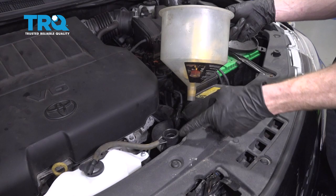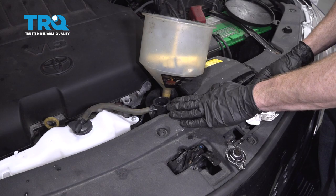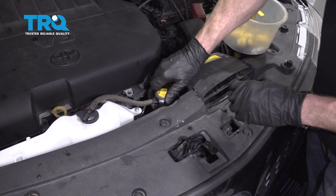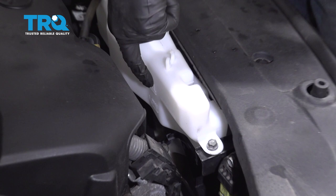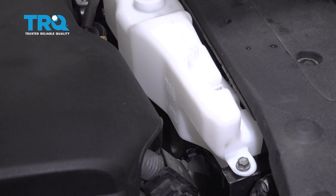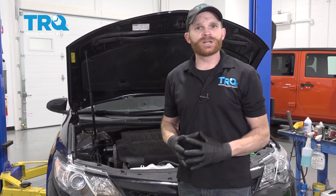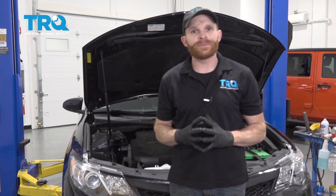The next thing you want to do is go ahead and fill up your cooling system. After you fill it, run the vehicle for a short while — we want to try to burp out any air that might be inside the system, so having a funnel like this is going to be helpful. Once you're sure you've burped out all the air in the system, go ahead and cap it off. Make sure it's nice and tight. Now it's time to fill the coolant reservoir — we only want to go up to the full line right here. You can go to the low line or anywhere in between, but the full line makes the most sense. Now start it up and take it for a road test. Pay attention to your gauges — make sure your temperature gauge doesn't go climbing up into the high range. If it does, more than likely there's still air in the system, in which case you're going to want to pull over and bleed it out.